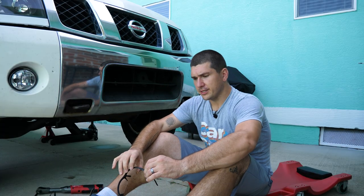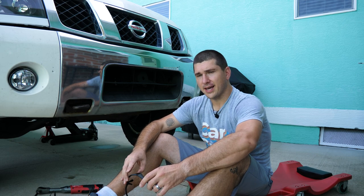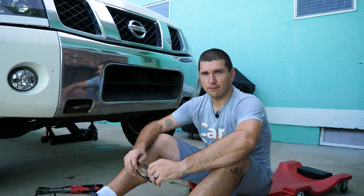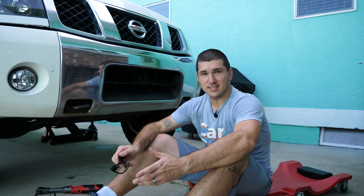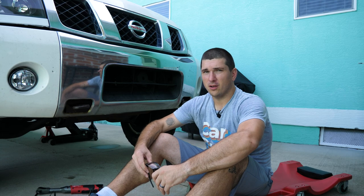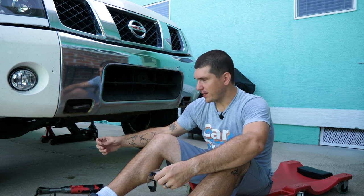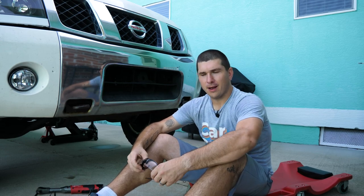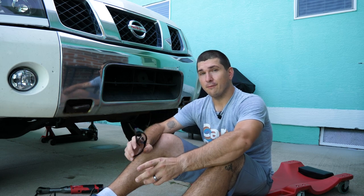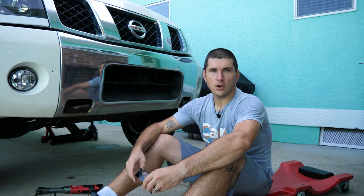That's pretty much it. I really avoided dealing with Rivnuts in the past — I kind of thought they were more complicated than they were, but turns out they're really not. These guns come in two sizes: 16 or 10-inch. Now that I know to set the correct stroke length, it's nice to have the additional leverage, but it's really easy to overpower the Rivnuts with 16 inches of leverage — I basically just pushed too hard and snapped the threads right out. That could also be a testament to the quality of the Rivnuts that come with the gun. Regardless, I'm happy to not have this rattling under the truck anymore. I'm going to go buy a proper M6 bolt to put in there, and then I'm done. If you liked this video, scroll down and click that like button, subscribe for more content, and if this video helped you save some time or money, you can say thanks by buying me a beer.